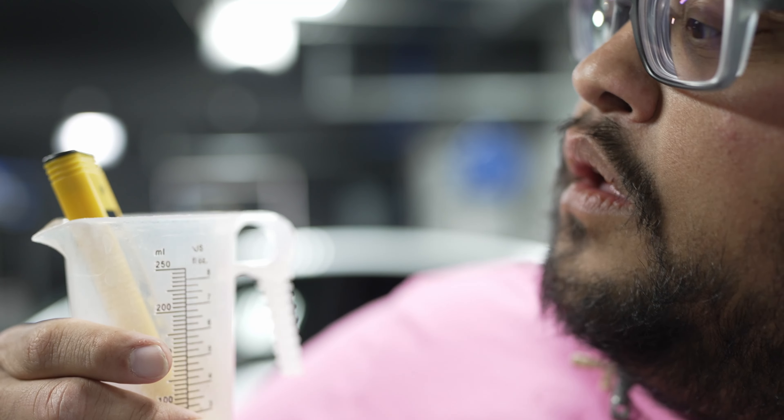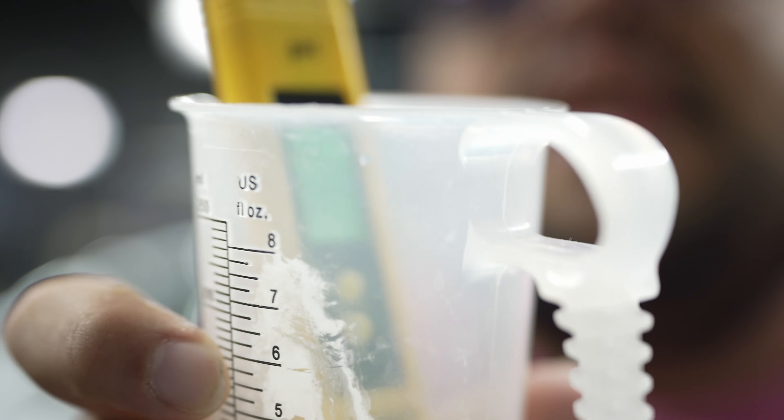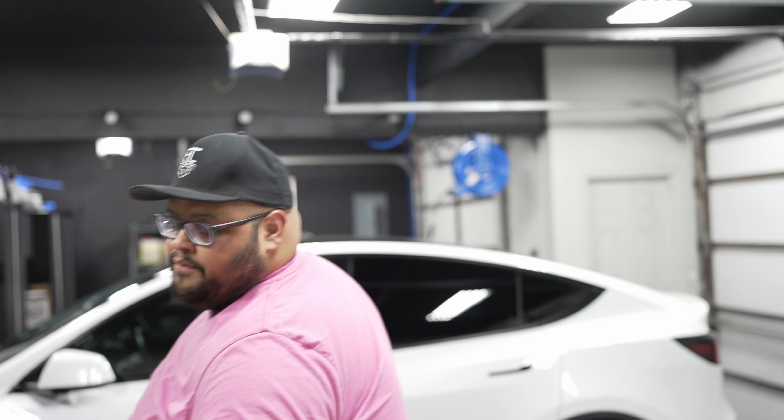Let's turn this on — going inside the cup with the pH meter. It's still dropping... okay. Now testing the TDS of my tap water: 372 parts per million. That will spot your car — that's hard water territory. The undiluted product reads a pH of 4.16 — so it is acidic straight out of the bottle. I'm calling this Koch Chemie's acidic rinse.